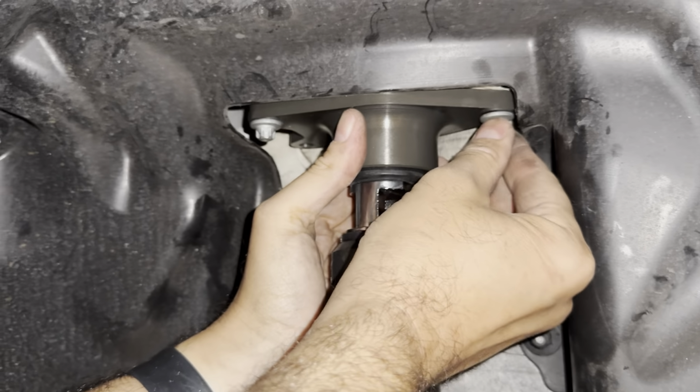Okay, what are we at? 48. Keep going. It's not lifting yet. All right, so we're past our point and it's still not lifted. So keep going. All right, that's our point there. So we just lifted off the jack stand, and that is 45 and a half. So we want to be at 47. So we need to adjust the shock length a bit.